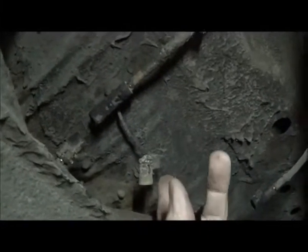I have the vent sawed through, and I have also sawed through the hose and disconnected the fuel gauge sending line. I have one strap completely removed and the other one with the nut walked down so there's plenty of looseness. The tank is ready to come down. I have drained it — you've got to drain it to get the weight off, otherwise you're going to end up with something on your chest. It's way too heavy.